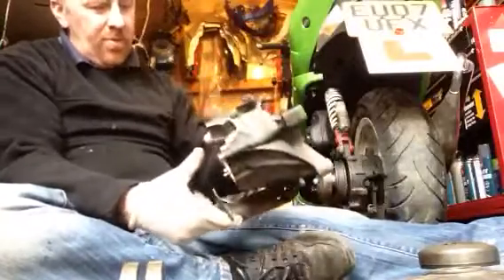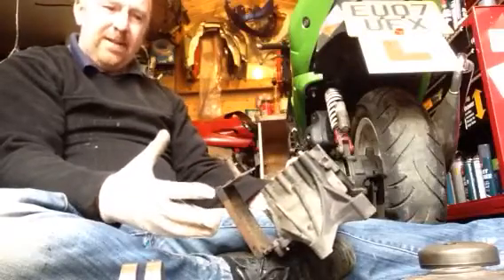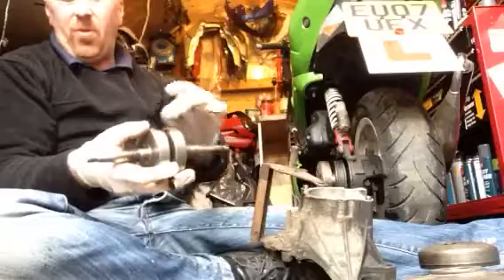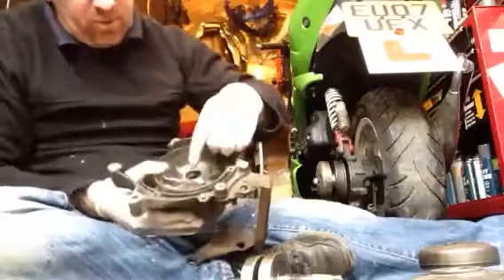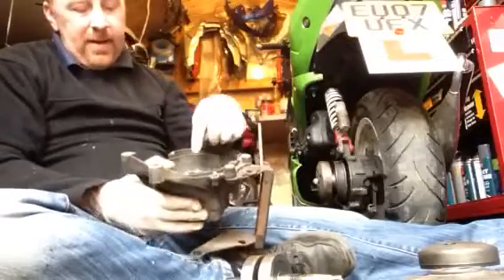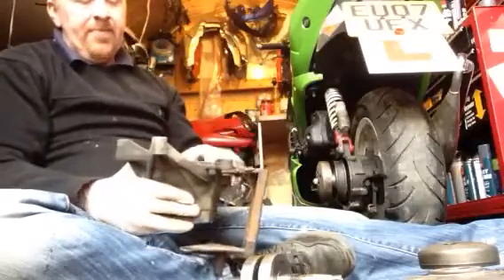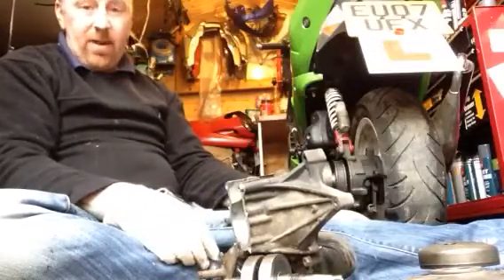So yeah, that's the best I can do for you guys. Unfortunately I've been trying to explain much more, because it is quite difficult to give you a detailed breakdown in the space of five, ten minutes. But yeah, that's the top secret - use two-stroke oil to oil the crank. A bit in the bearing if you want to - it'll be fine. You don't really need to do these because they'll get oil around them. You must put your oil seals in now - don't try and get them in after, you'll never fit them in. Would I replace the oil seals if I'm replacing bearings? They're eight quid - it's a no-brainer. I would most certainly change both.